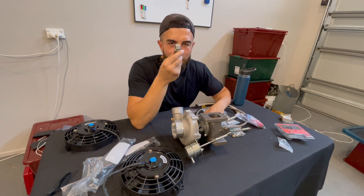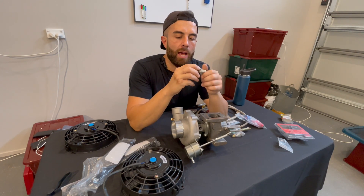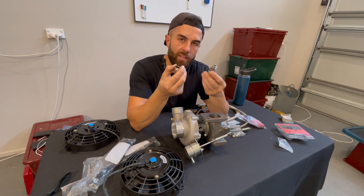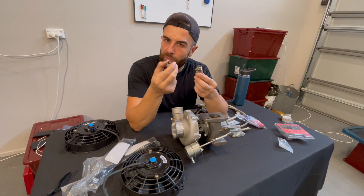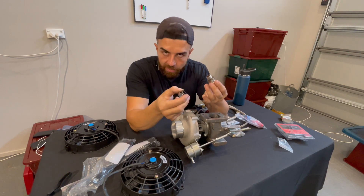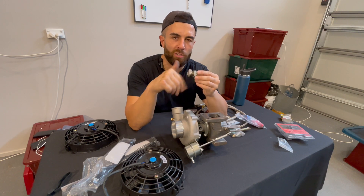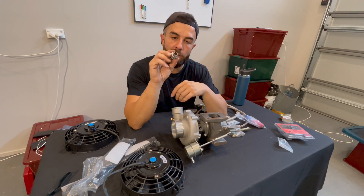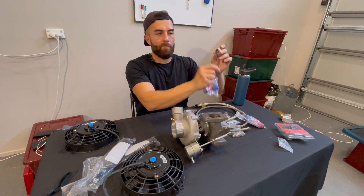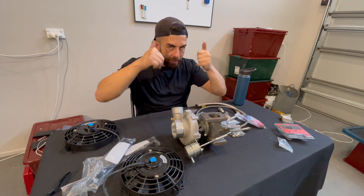Option B was hiding — here it is. This is how to tap your sump without welding: a no-tap fitting. It's definitely under 30 bucks. You drill a hole in your sump — you do still have to take the sump off — then fit this O-ring rubber seal, apply thread locker, go full send on the tightening, and your sump now has an oil drain option that one of these fittings will happily fit into. I've used them myself — if you fit it properly it will be great.